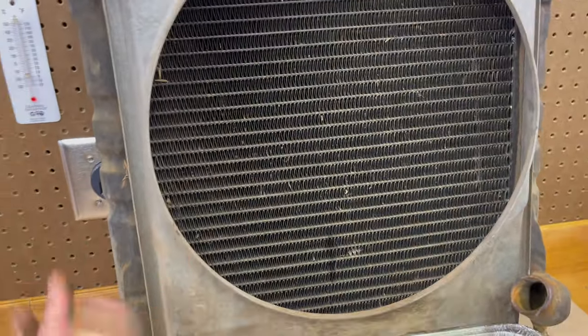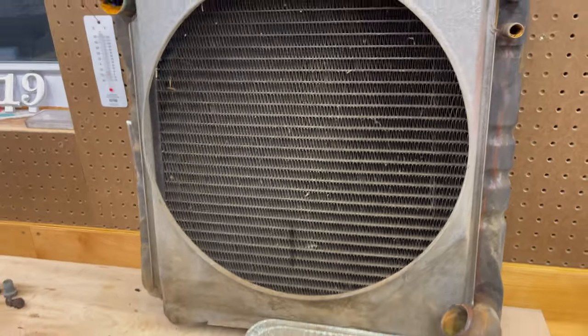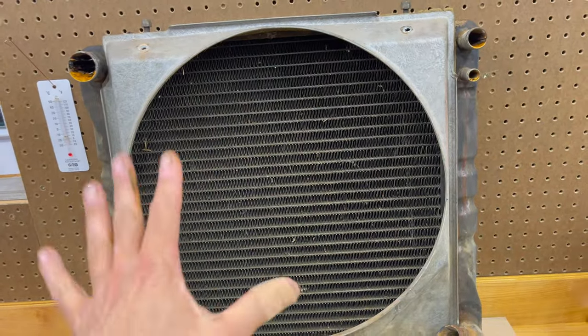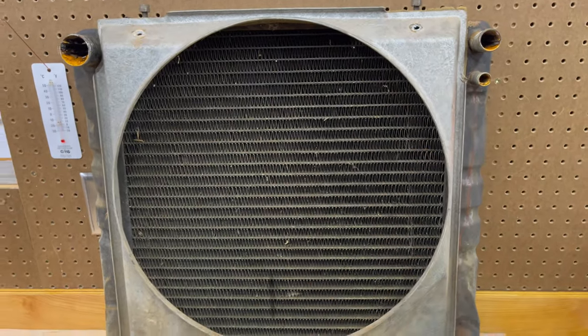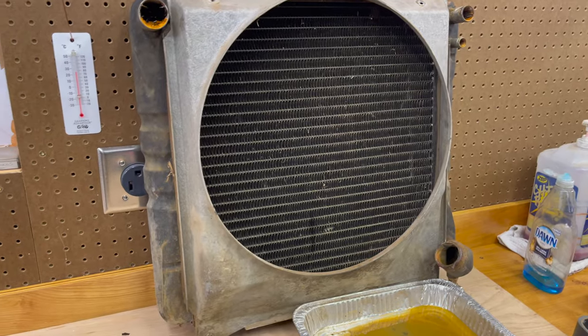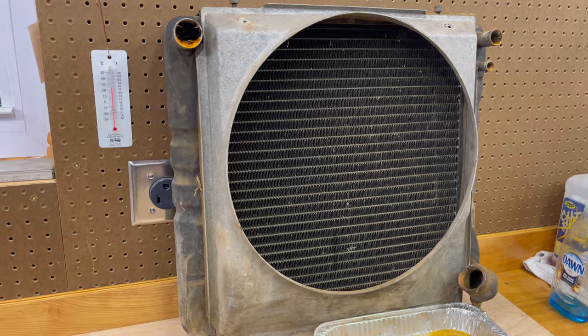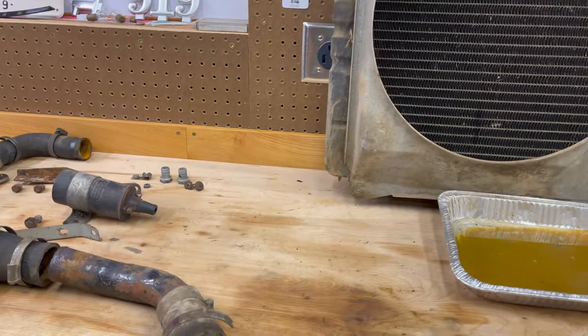And I actually have a lot of experience with that with older antique cars. On really old antique cars, they don't have little tubes to go like this. They have these crazy little, I don't even know how they made this stuff, but it doesn't go straight. And if you want the radiator to look original, you've got to use the original one, and you've got to get it flushed out. And so basically that just takes patience and persistence and a lot of water pressure.